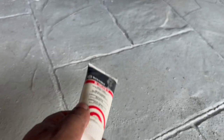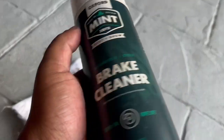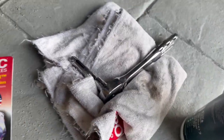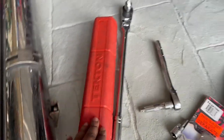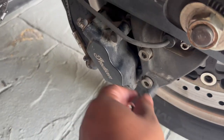You're going to need an 8mm hex bit, some silicone lube — don't use regular lube, use silicone or brake-specific lube. I'll show you where you're going to put it. You'll also need some brake cleaner to clean the brake disc and the brake calipers, and some wrenches and a torque wrench for tightening up at the end.